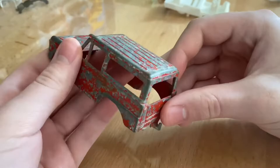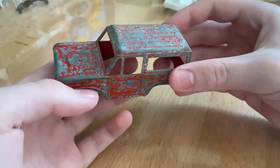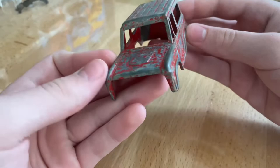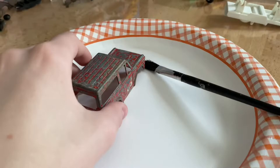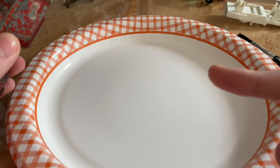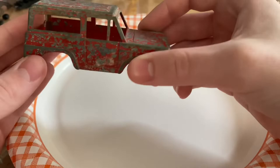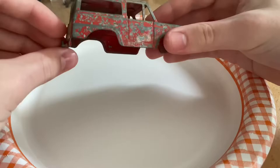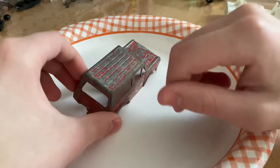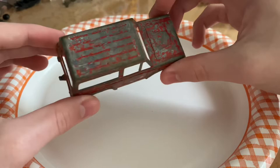Next up is the body of the Bronco. As you can see there is some red paint still left on here so I need to get all of this paint off. So what I'm going to use to strip the paint off is Citrus Strip Paint Stripper. You can just get it from Walmart in a big container. It's probably one of the safest paint strippers you can use and it always pretty much works as good as it can. What I'm going to do is use an old paint brush and a paper plate. I'm going to take this outside, brush on a couple coats of the paint stripper, let it sit for a few hours, and then wash it off and we can see what kind of damage and body work needs to be done.